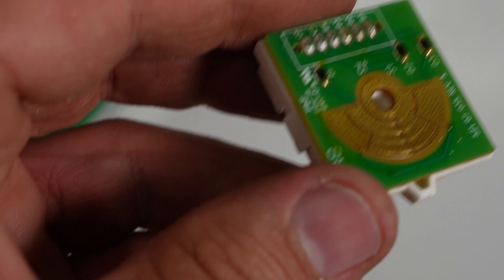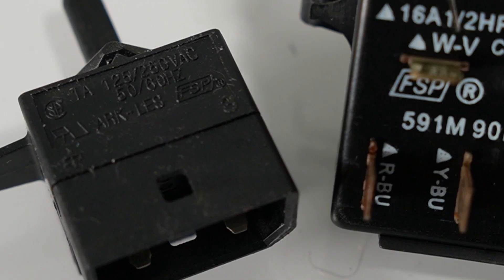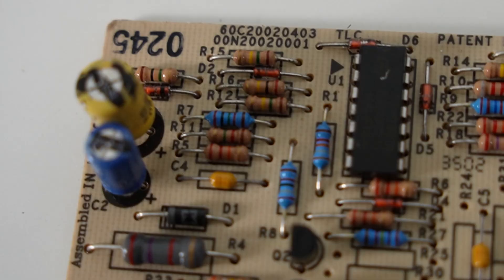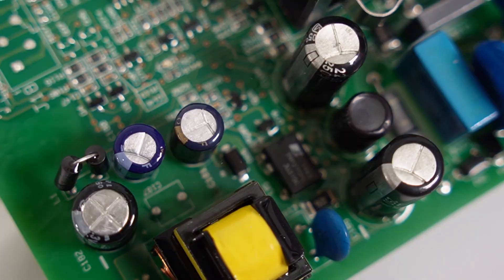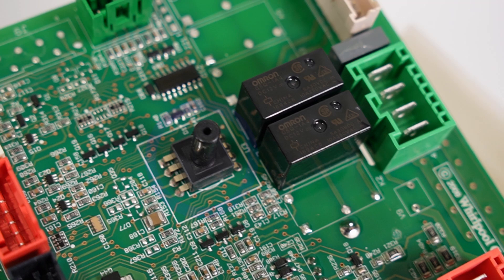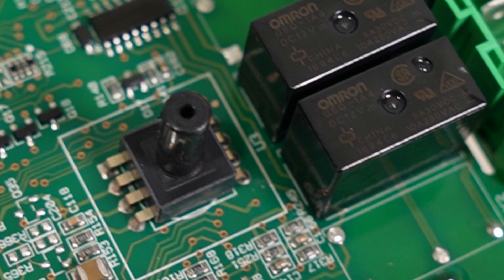The technology within the control board eliminates the need for physical pressure switches and simplifies many runs of electrical wires going to and from the selector switches. The rotary switches are simply there to allow the user to select options, and there really isn't much other than the rotary selector inside them. Even on the old washer, there's one electronic control board that's intercepting and interpreting mechanical signals. When we get up close with the electronic board, there's a beauty and a beast within the system — a lot is being asked of these relays, capacitors, and other components. The pressure switch that interprets air pressure is bolted onto the system and soldered in place, among other things.